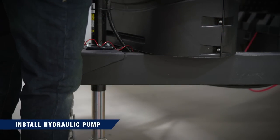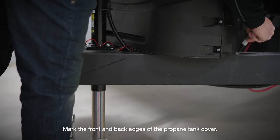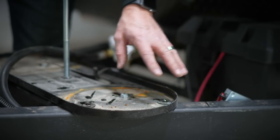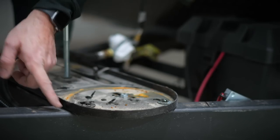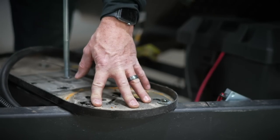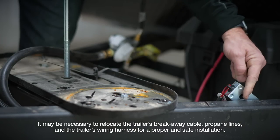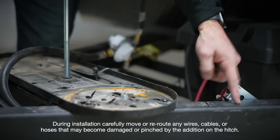Now we're going to get the trailer prepared to mount the hydraulic pump assembly. If you've got a propane tank cover, mark where that cover sits on the trailer, then get the cover off and remove the propane bottles. In most cases, the propane trays are held to the trailer using self-tapping screws, though every now and then they may be spot welded. If you need to move them, grind the spot weld out, shift the tray back to give you the two inches of minimum clearance needed, and reattach using those same self-tapping screws. This is also a good time to check the frame for any obstructions. In this case, we have a breakaway switch on the inside of the frame right where the pump bracket goes, so we'll remove the self-tapping screw holding it and shift it further forward out of the way.